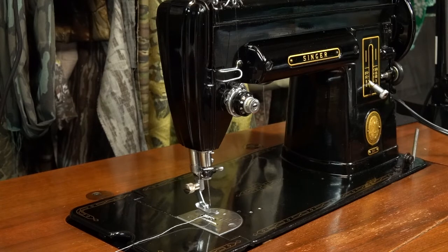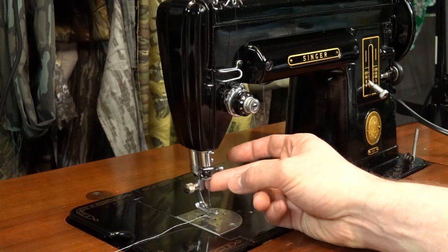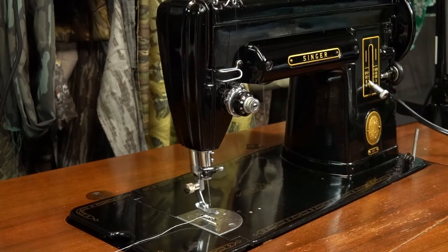The only weak points this machine would have are the same weak points that any vintage machine would have — the hook obviously could be damaged. The hook is what catches the needle thread and wraps it around the bobbin case in order to create the stitch, so the hook could be dulled or damaged. It is possible to get a case stuck inside the machine. I didn't have to do any hook timing with this machine, but I know from timing hooks on 201s and 1591s that it takes a little bit of time — some reading through a Singer adjuster manual or a YouTube video — but it's not too difficult.